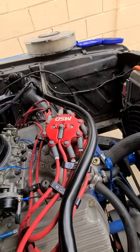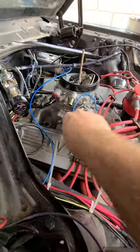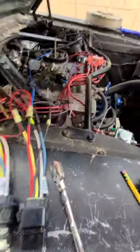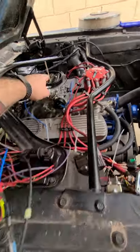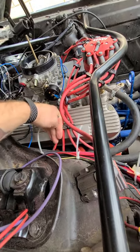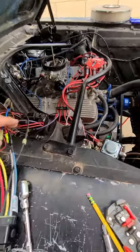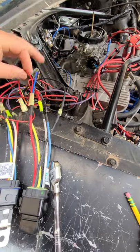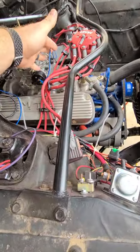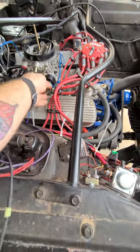It's a little tighter than a number two pencil but that'll work. So what happens is when this gets 12-volt key-on power, this will slowly start to open as it warms up. Now this engine is ice cold - it's about 70 degrees outside right now, first thing this morning. I tapped into here which I think ran to the MSD - maybe not a great idea, but that's how we're gonna run it. This is only temporary because I'm gonna hide this better.